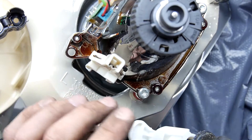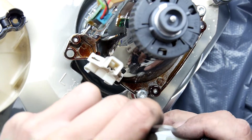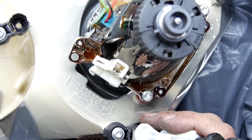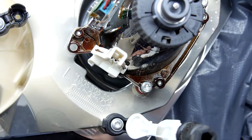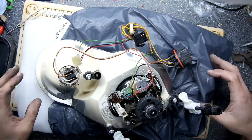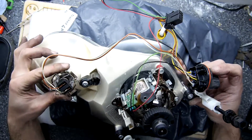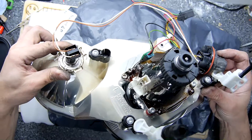There's another ball joint here for the pivot. Let's see how difficult it is to release — there's a release mechanism and it would be very tricky; you'd have to push something in there to spring it back. I think just using the same method of sliding the whole assembly out is best — at least when you put it back in it should align the same way. I hope that's been of some use. Please like, share, subscribe, keep enjoying your vehicle, and save yourself hundreds of pounds by just being a bit interested in your own equipment.